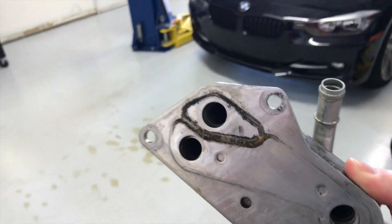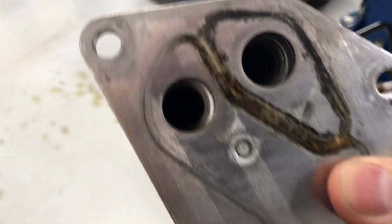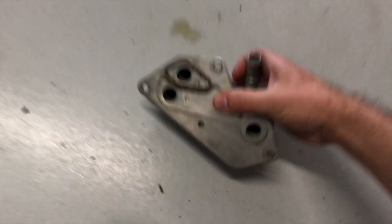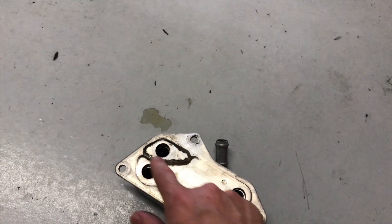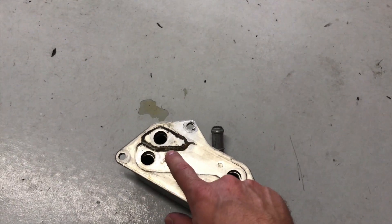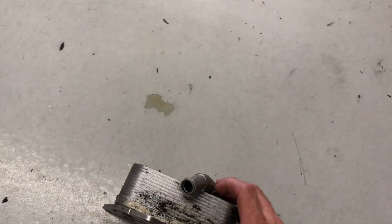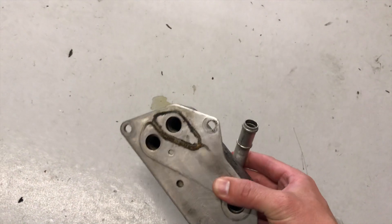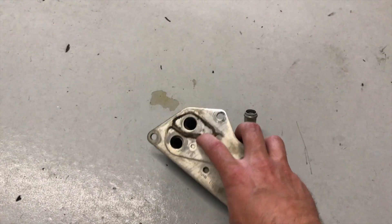This is the culprit right here. It had a little bit of electrolysis action right here. Right here there's coolant and right here there's oil. There's a gasket — you can see the ring around here — that separates the two. The gasket pretty much melted and the two mixed together right here. We don't take any chances; you just replace the whole thing just in case. Besides, there's a lot of etching in here. You don't want to reuse this thing.